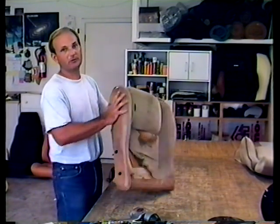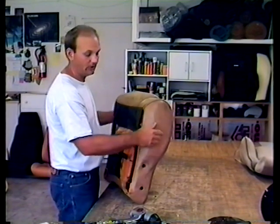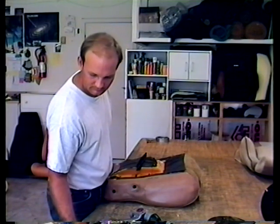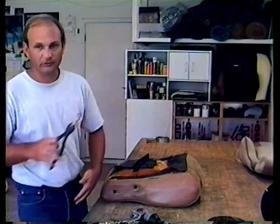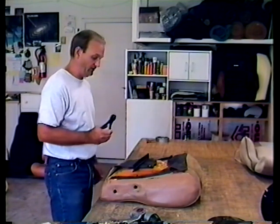What we're going to do is remove the hog rings from the bottom so we can peel it up, and then remove the interior hog rings. You use a dykes — or a diagonal cutter — that's what you use to twist the old hog rings off.